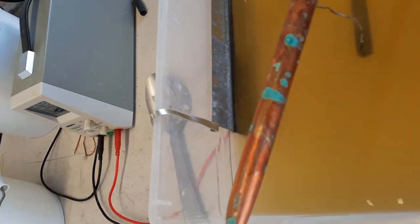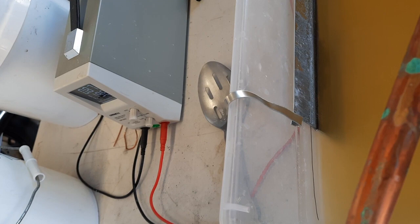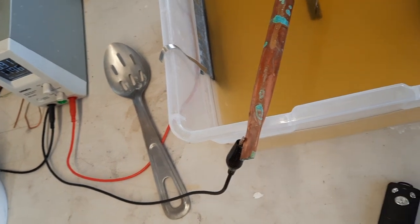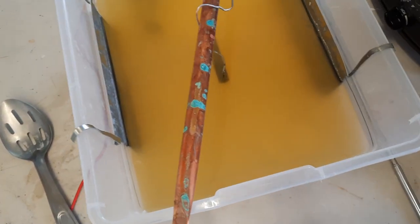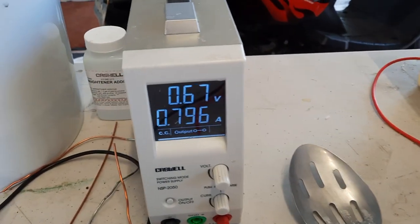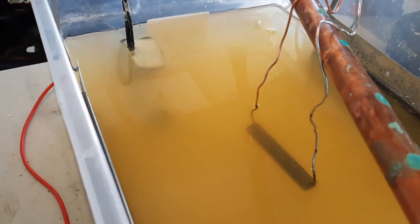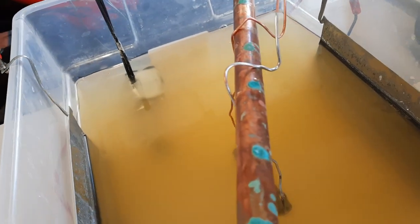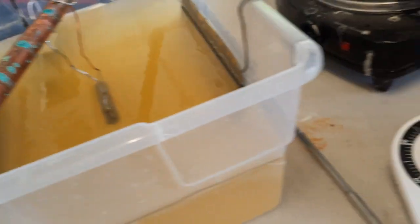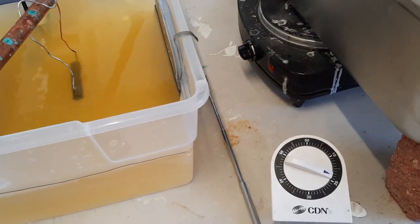And there it is inside. And it looks a little too strong to me. I don't know. I'm not sure. So I don't see as much. I put the amperage down to like 0.8. And I don't see it foaming as much. It was definitely foaming before down in the pickle juice. So it is plating. Let's set our timer for, I'm going to say about 18 minutes.